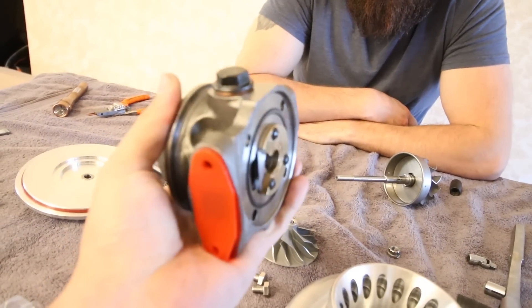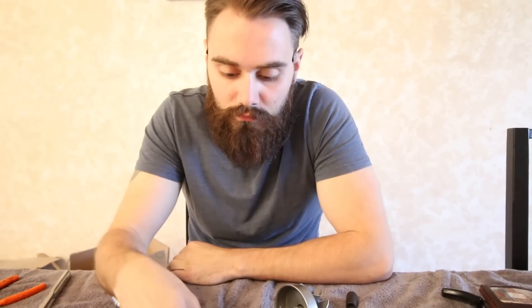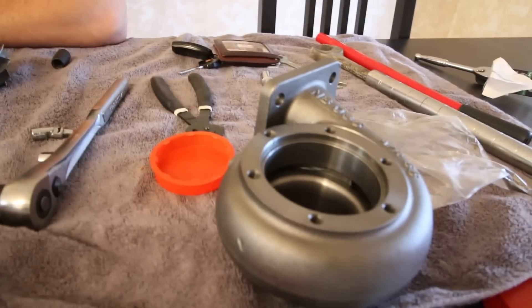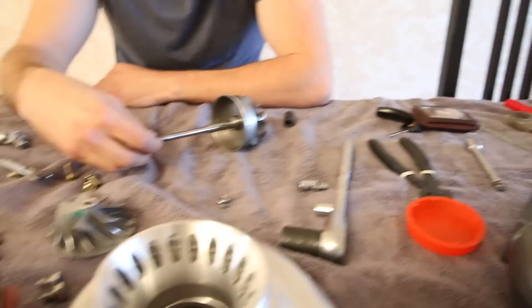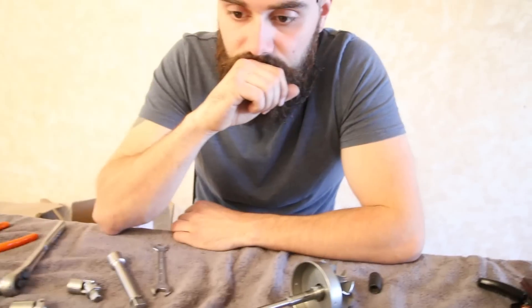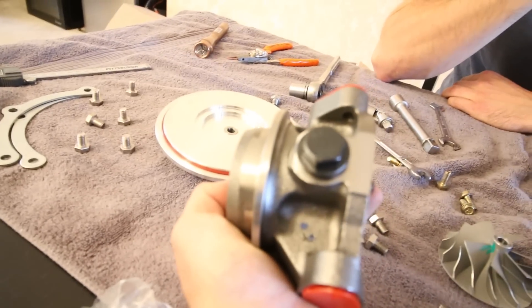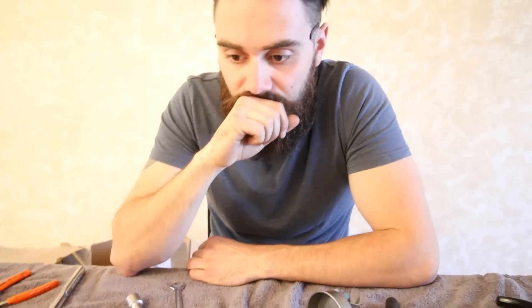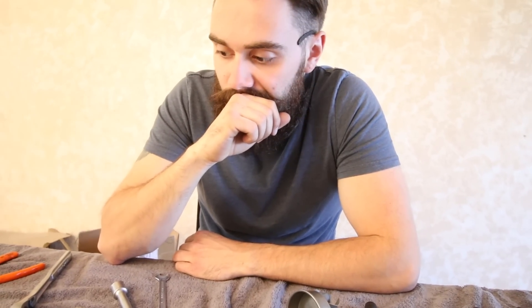What you could do is buy an actual centerpiece — they sell these — and you could get a real GT35 from Garrett and just put these compressor housings on it. That would be cheaper than getting a brand new Garrett GT35. There's nothing wrong with this compressor housing, there's nothing wrong with this exhaust housing. You can get this turbo for $400, and I'm pretty sure you can get the GT35 centers for around five to six hundred bucks. So you could have a real GT35 for about $1,000, as compared to new ones which are like $1,500 to $2,000 — super expensive.